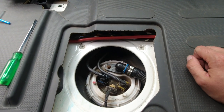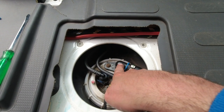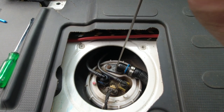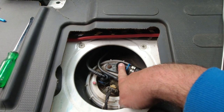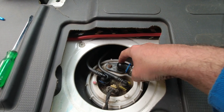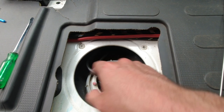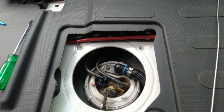Recently I found on the internet that some people just drill a hole into the breather pipe here and insert the pipe there, because underneath this breather pipe there is a larger hole that goes straight to the tank. So I will try this option — just drill a hole here and insert the standpipe. For that I will need to remove this nut and take the breather hose out, drilling the hole carefully to make sure no debris go into the diesel tank.